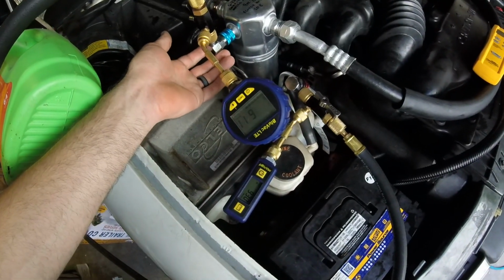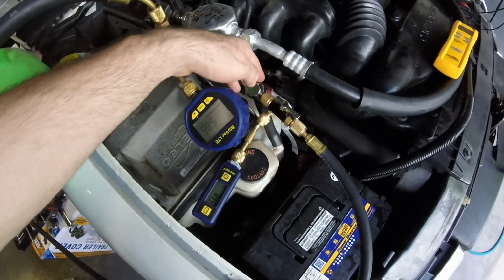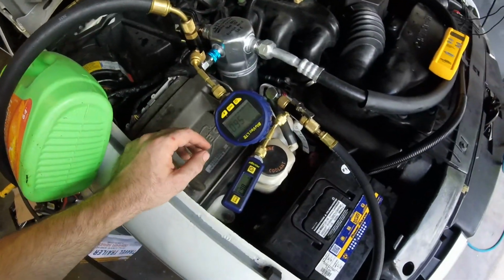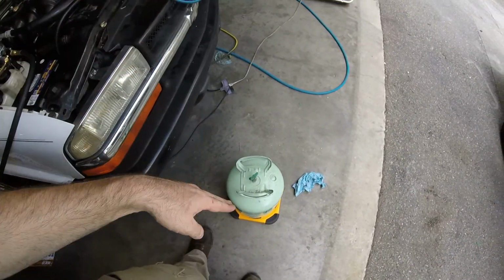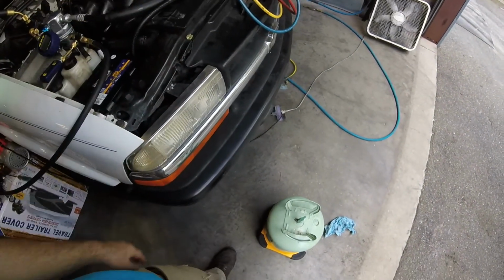My concern is I don't know how vacuum rated these are. They're probably not vacuum rated. So our leak might be just right in here, trying to keep my hose from pulling on it. So our next step, we're going to go ahead and get my hose hooked up to the gauge, get the drum flipped upside down, get it zeroed out, and we'll start to charge it.